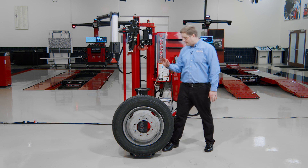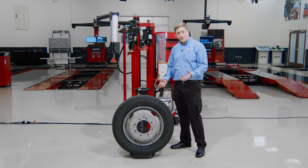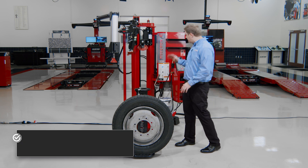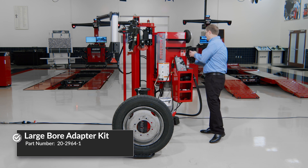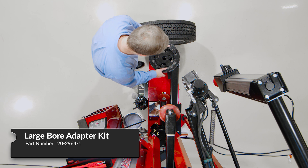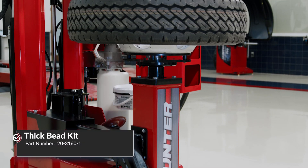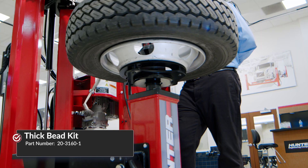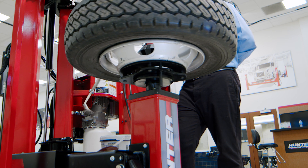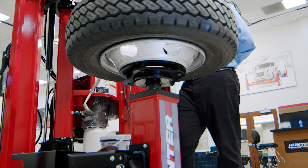I have a 19.5 assembly here — this is a 14-ply tire, so this is a fairly difficult assembly. But I've got all the power I need and all the tools I need. I just need to employ some different techniques and different clamping to handle this wheel. I have a 19.5 clamping plate that I'm going to put down first. In addition to this 19.5 plate, there's a half-height adapter included in the thick bead kit that actually installs in place of the platen to keep the stack height low on 16.5-inch and 17.5-inch wheels with reverse drop centers. So let's get back to this 19.5 here.